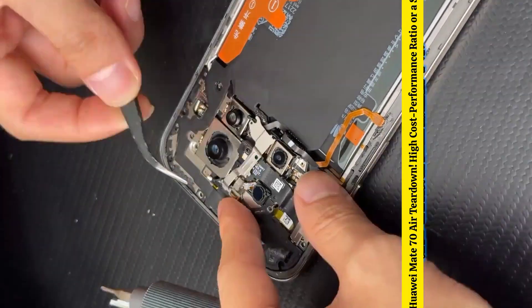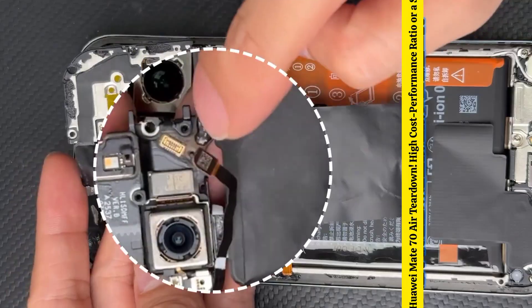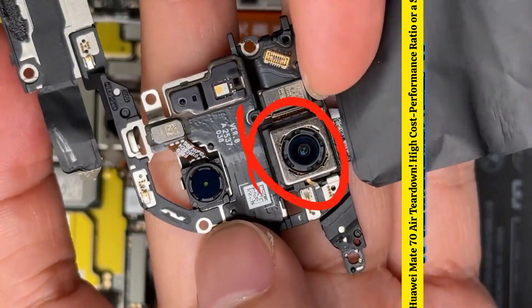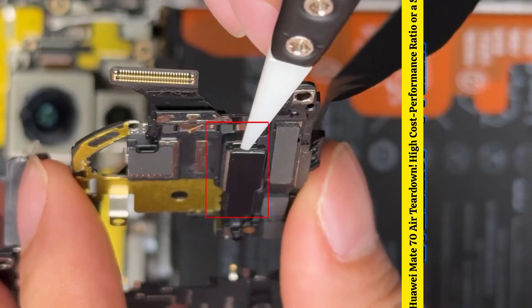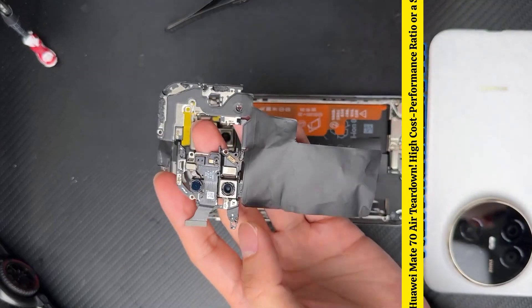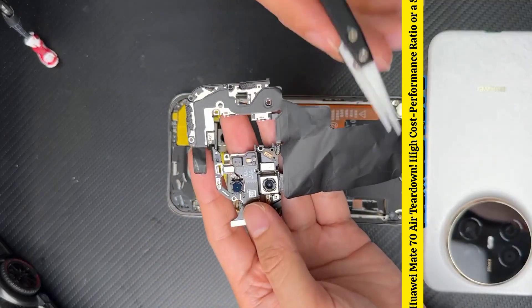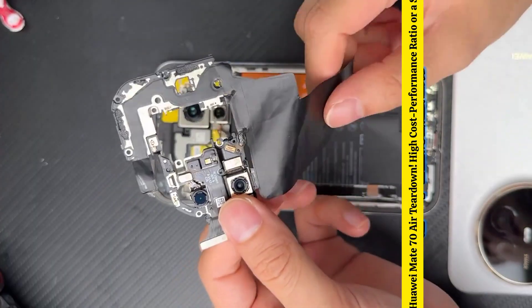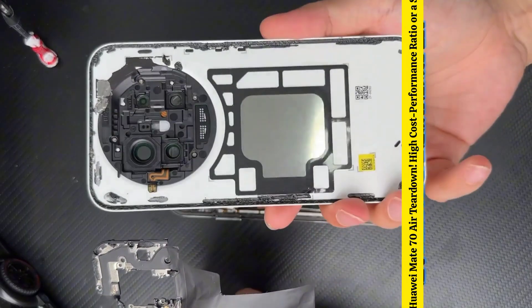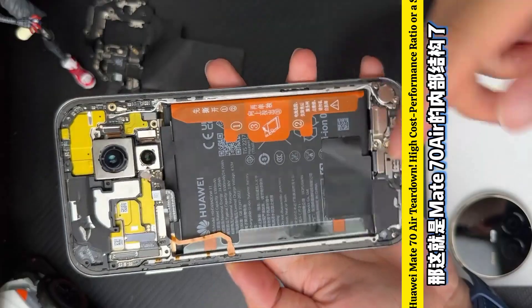Now let's remove the motherboard cover. During disassembly, I saw the side fingerprint sensors linked to the motherboard cover, and both the red spectrum camera and ultra-wide-angle camera connect directly to the motherboard. Turning over to the back of the motherboard cover, you can see there's a small subboard hidden inside. Huawei's level of component customization is very high. The flash uses a monochrome design, which is a bit of a pity — compared to dual color temperature flashes, it may not render skin tones as warmly, though the red spectrum camera may compensate. The lower half of the mainboard cover has a graphene heat dissipation sticker. The Mate 70 Air does not have wireless charging, which is understandable in order to accommodate a large battery at this thickness.